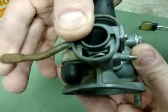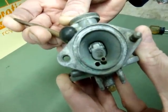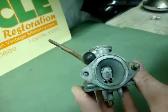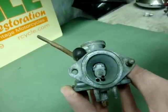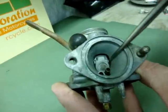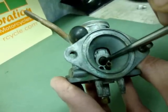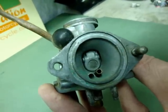When we lift this lever, you can see that it actually pushes that down. If we look into the air horn of the carburetor, we simply shut a small door in here, and that actually just closes off all of the air coming into the engine and allows it to draw more fuel for a cold start application. One neat little thing about this system is that it's engineered so that you can also start cold. It does not raise the idle, so again you have to babysit the throttle. But because this valve closes completely and an engine will not run without some air even when it's cold, they put a little spring-loaded trap door in here that can actually allow the engine vacuum to pull that open and draw just the amount of air it needs to stay running when it's cold.